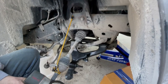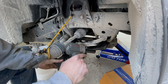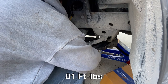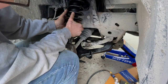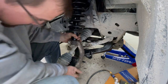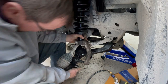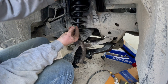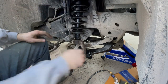All right, so what I'm gonna do now, actually, is before I put that strut in, I'm gonna line up this lower control arm at about ride height and go ahead and tighten down these bolts, and we'll go from there. Put this in first up here. Okay. And concentrate on this. That works better. Get that in first and then throw that on. Just gonna throw these nuts on here so this doesn't go anywhere. I'll put some anti-seize on all these threads whenever I go to tighten everything down.